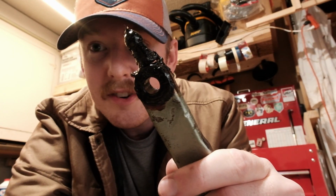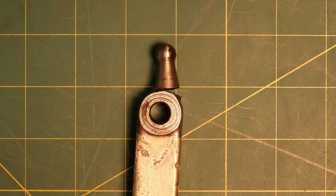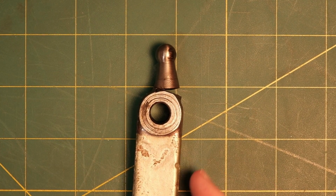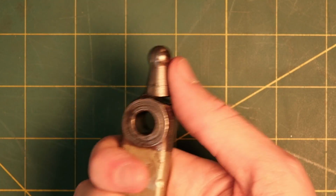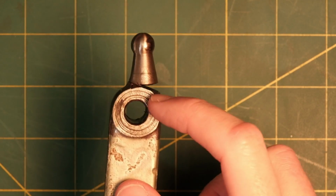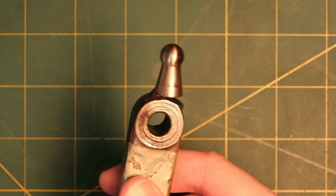It's completely sheared off. The reason this wasn't obvious to me in the beginning is because that nub is actually still held on by a good bit of metal. I can't actually push it over with my thumb. It's on there pretty good. It wasn't until I fixed that clevis and shimmed the slave cylinder that the hydraulic force had enough to open up that crack further and further.